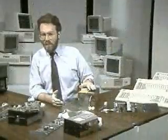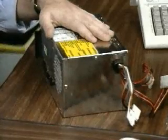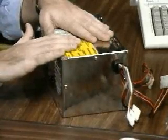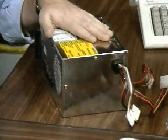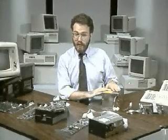The power supply converts line current to direct current used by the PC. In general, you won't fix the power supply. You'll just replace it. Power supplies are rated in watts. The higher the wattage, the greater the capacity, and in general, the larger the fan. A larger capacity power supply means your PC runs cooler and lives longer, so don't just purchase the minimum.